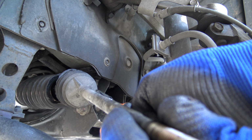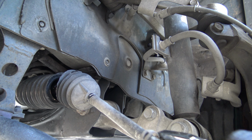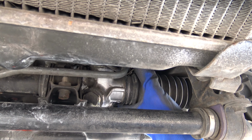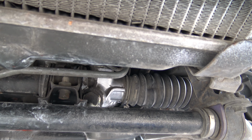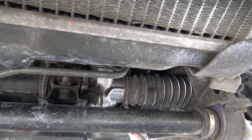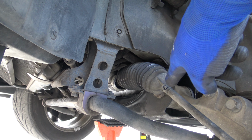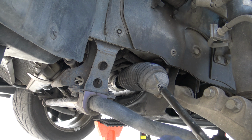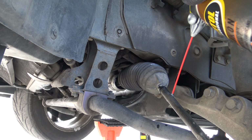The steering boot is held by 2 clamps. One is easy, you may remove it with the pliers, and the other is not so easy. It's an old style fix. Just turn it if you need and remove the wire. Use some lubricant, better if silicone based, and clean also the arm. This will help. And with a flat screwdriver try to enlarge the boot and pull it out.